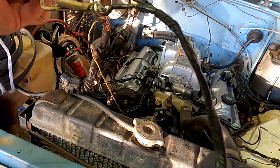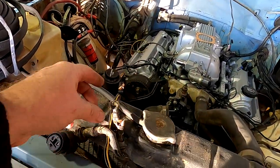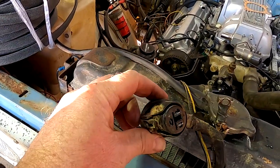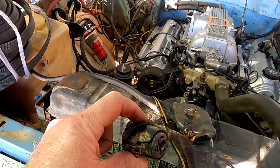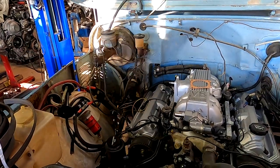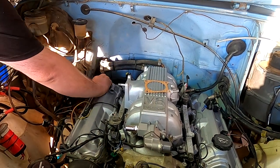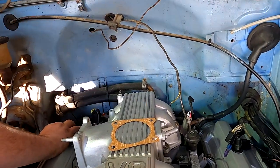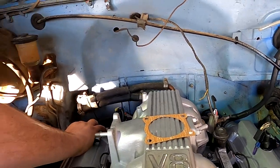Kelvin notes the quality of this build is really special. The alternator plug changed from round to oval as part of the main engine loom. The standard relay setup will work with a couple of modifications. They still need to find the water temp wire and the alternator light wire inside — one of those wires coming through is probably water temp, based on its color: yellow-green is the right color for water temp.